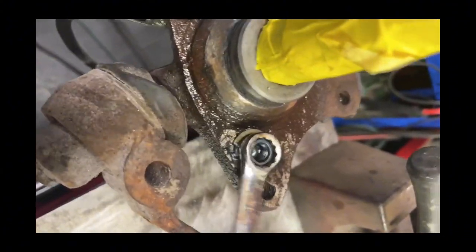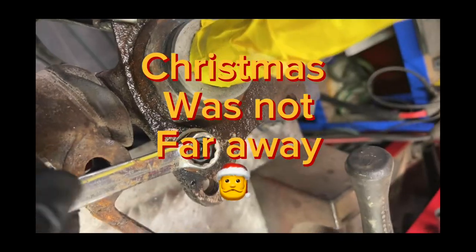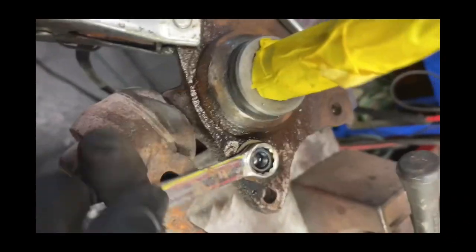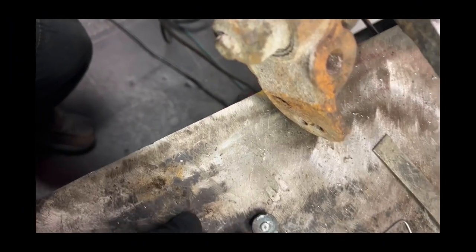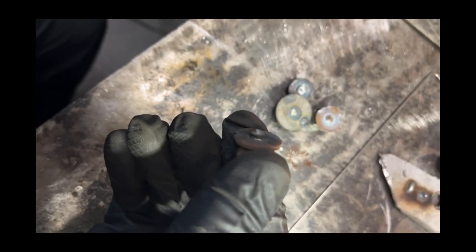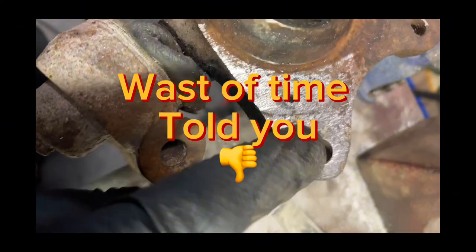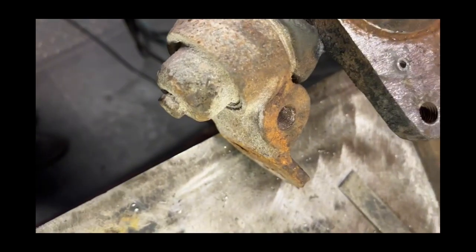It's coming, I think - but I don't want to put too much on it because it'll probably snap off, so I'm just going to work that in. Not much luck here - one, two, three, four, five attempts - but I got five goes and as you can see it's been pulling a little bit out each time. This is a bugger. I haven't got any quarter UNF taps, I've only got a thread cleaner, so I've decided to drill a hole in it.